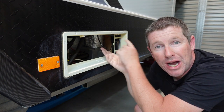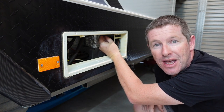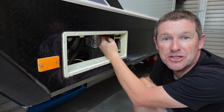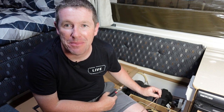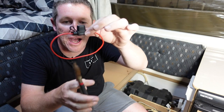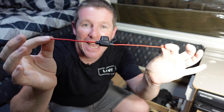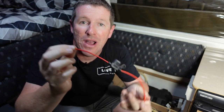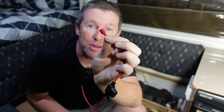There's not a great deal in the cavity to tie onto — we've got our wastewater pipe running through which is probably best as it won't get hot. Cable tie it onto that so it's secured behind the cavity of the van, and then the cabling runs up to the opening where the upper vent is. Now that the cable is run through I've measured the length I need to terminate onto the back of the battery management system, so I'll cut the cable to the correct length. With the fuse, cut it so you end up with a length out of either side, and while connecting to a fuse terminal I'll also put the 7.5 amp inline fuse in as added protection.